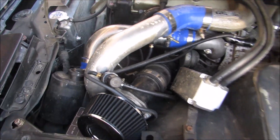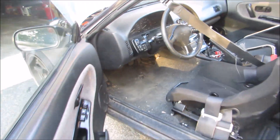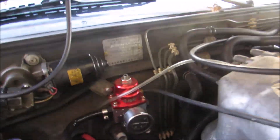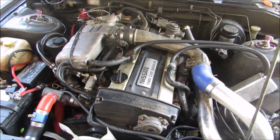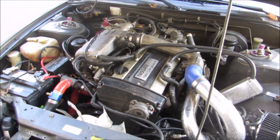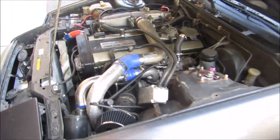I wouldn't have done that if I didn't have my AFR installed. I've been keeping track of my AFR because if it started running lean on boost - say running 14 AFR on boost - I just went over to my fuel pressure regulator, took off the vacuum line, and you screw it out to increase pressure. Right now without vacuum it's probably like 47-48 PSI, and I found that amount of fuel pressure works well for the amount of boost I'm running. In boost, the AFRs are like high 12s to low 13s, which I've heard is kind of lean - you don't want it past like 13.5.